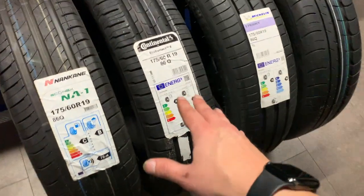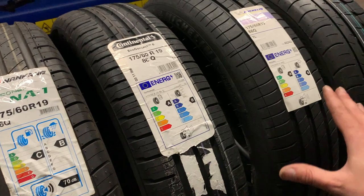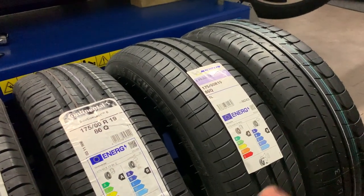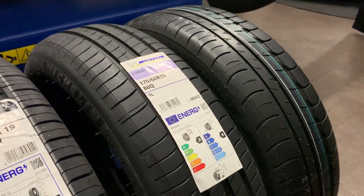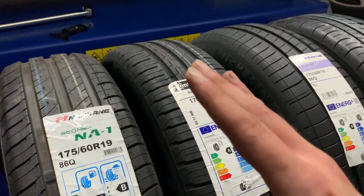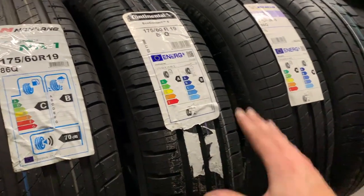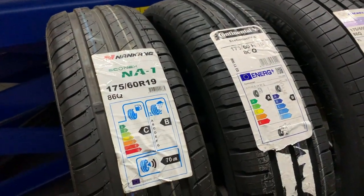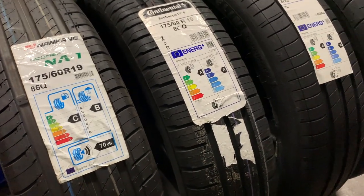So this is what was most commonly ordered when we're selling the Michelins. Personal observations — I think there's not much in it. The Bridgestone, for reasons unknown, comes with very little tread. The EP600 tyre starts from new on the inner edge with about 2.2 or 2.4mm — really not fair, considering it's quite an expensive tyre. But the Michelin, Continental, and Nankang bring a lot more value for money. One major observation in terms of ride: the Nankang is a noticeably louder tyre — whenever we get a car in on Nankangs, we sigh, because as soon as you drive it you get a lot more road noise and a bit harsher ride. I'm not a professional tyre reviewer, and this is exactly why we want to get someone in who really knows what they're talking about. But we have sold over 300 of these and driven probably close to 400 of them.